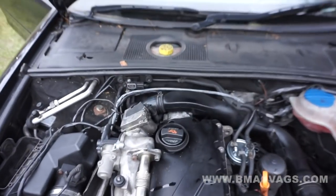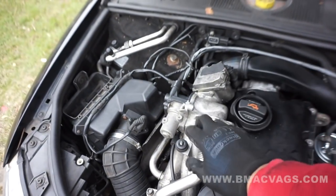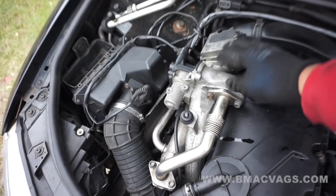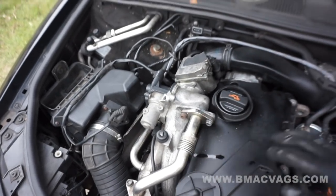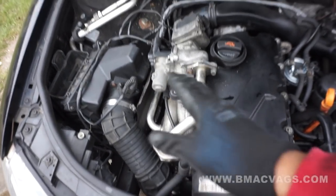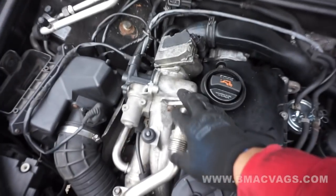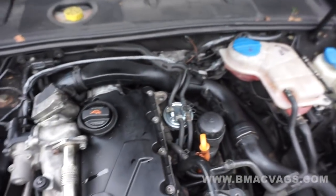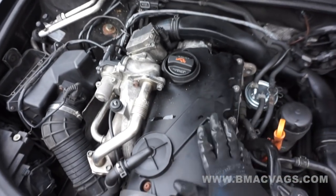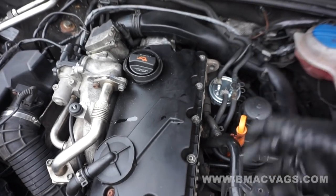To understand your car — what we're going to try and do is get some water into the intake. This is the main intake, but it's turbocharged by the time it comes up to here. We don't want to do it at the turbocharger because we don't want anything hitting the turbo. So we want to do it after the turbocharger, as close to the inlet as possible.